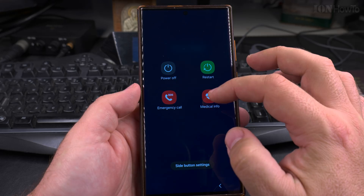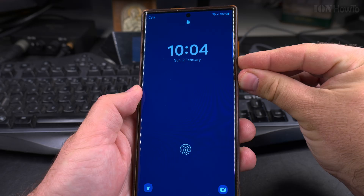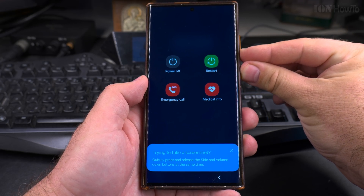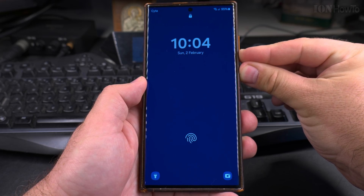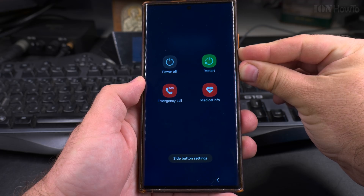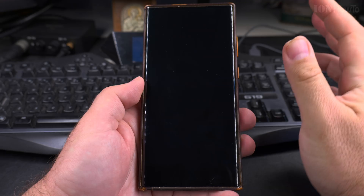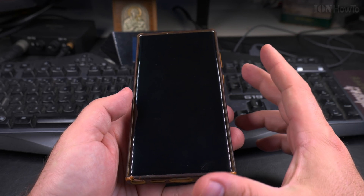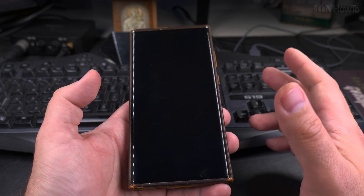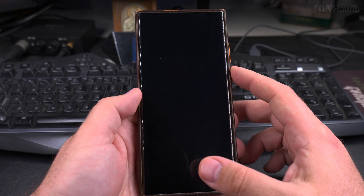So I'm here in this menu and trying manually — it's asking for the password or fingerprint. But if I long press the power and volume down buttons and keep pressing them — I keep pressing — and now it's restarted. So it's not about powering it off after all. Without the passcode you can't really power it off, but you can force restart with the volume down and power button.